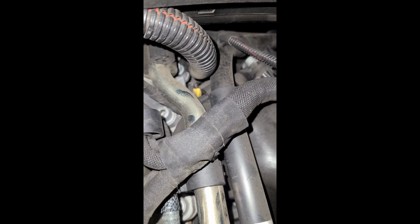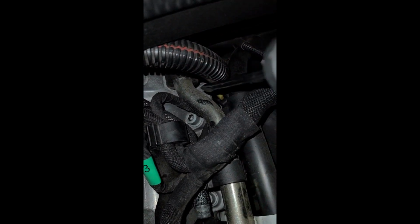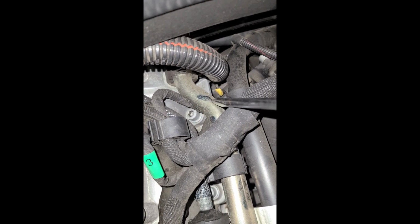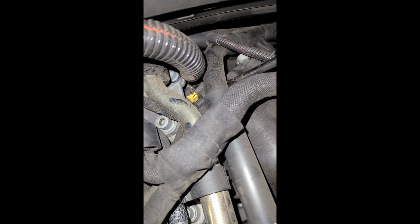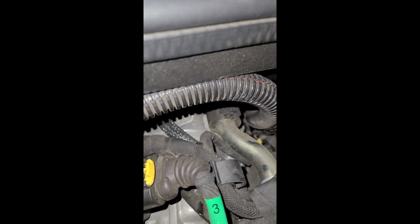This is going to be a pain in the butt. This, by the way, is the wire that goes down to the connector. So when you pull the connector, that'll come up here. You have to route the connector from the JB4 down here and then push it in. So to do that, get over here, pull this tab like so. See that go out? Then we have to push down on this right here and pull the connector out, which is going to be easier said than done.